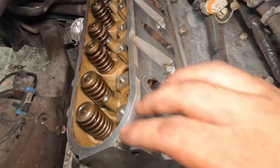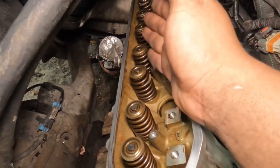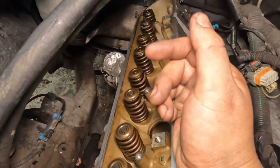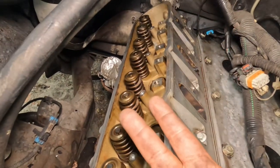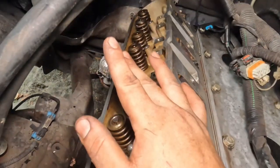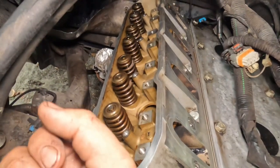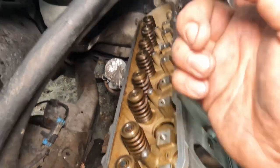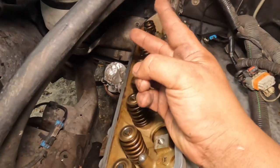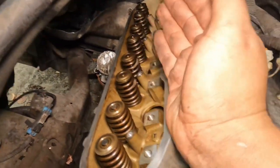All right, so as you guys seen, there's 3 passes for these 15. There is 22 foot pounds, and I'm gonna go over it in my edits. Second pass, 90 degrees. If you have the digital one, it helps out a lot. If you have the old school one, I don't even know what it's called, that might be a little tough for the ones in the back. But anyways, 90 degrees. Second pass, third pass, 70 degrees, and you're good with the 15.